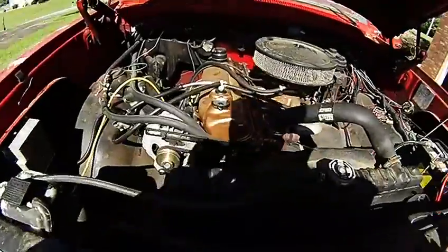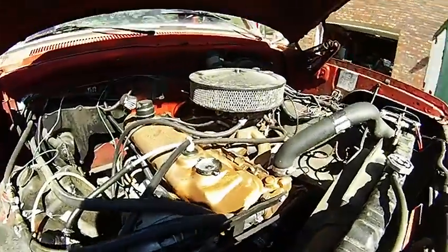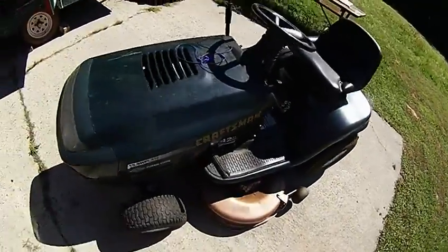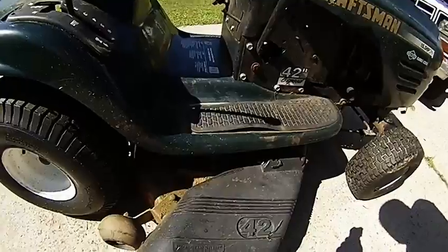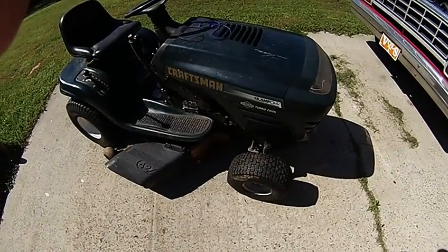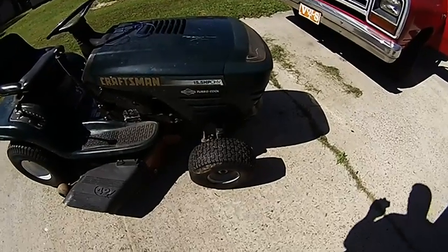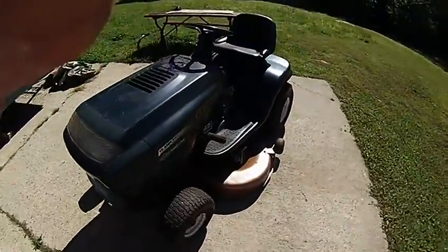For you it's only been a few seconds, but for me it's been several weeks — long enough to have surgery, recover from surgery, and rebuild this free lawn mower. I had to take the deck apart because one of the spindles where the pulleys came through came apart and chopped up the mower deck. I painted it in the same coppery color left over from the engine. Two new tires, a complete rewire job from stem to stern, some professional Gator blades — give them a try if you haven't. Rebuilt the carburetor and it runs great.